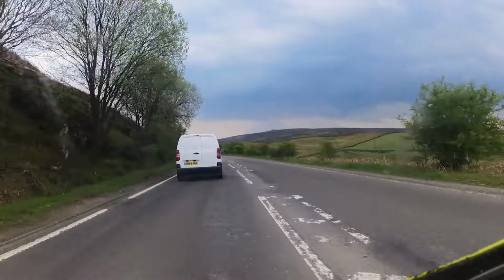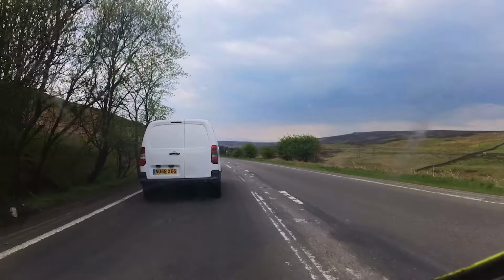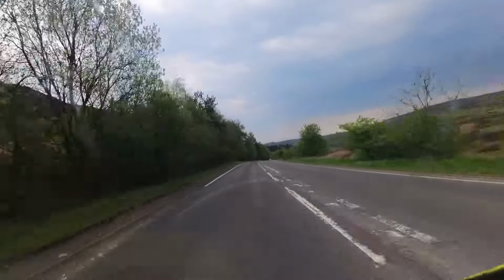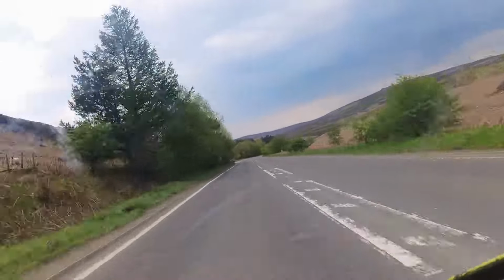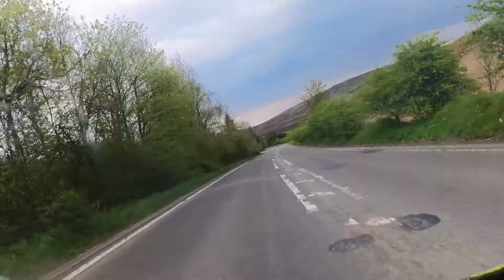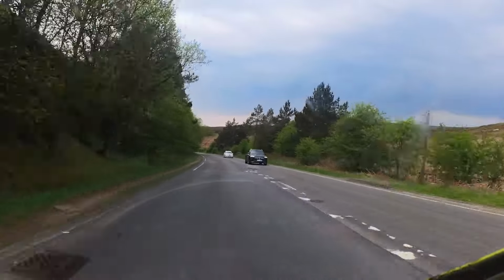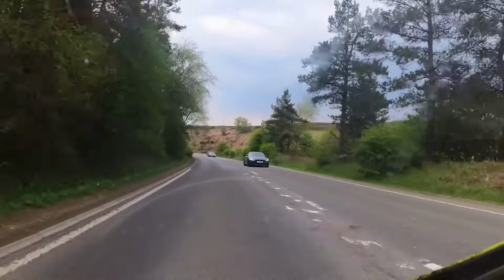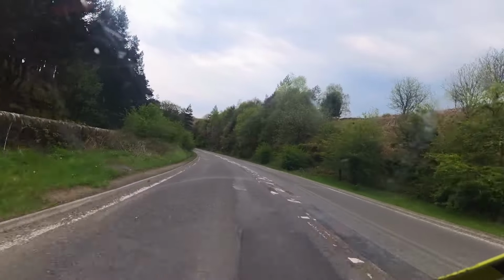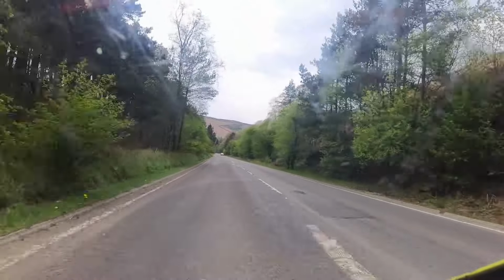Brake juddering like that is either warped brakes or loose headstock bearings. People overlook that a lot. Actually, it might not be that bad. A loose headstock bearing sounds terrifying, but it only needs a slight bit of adjustment and it will be fixed again. But it's not nice when you hit the brakes and you find it all juddering up front end like that. Does it inspire confidence? Let's have a little braking section here.